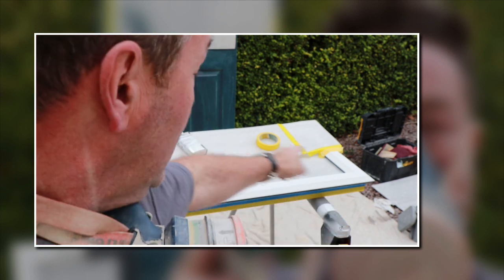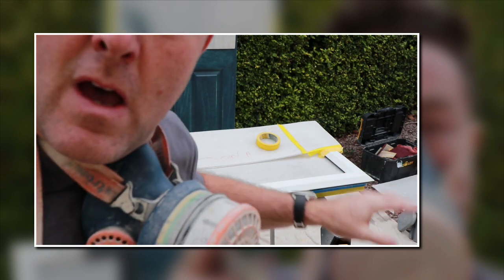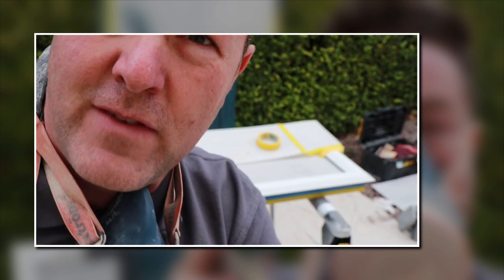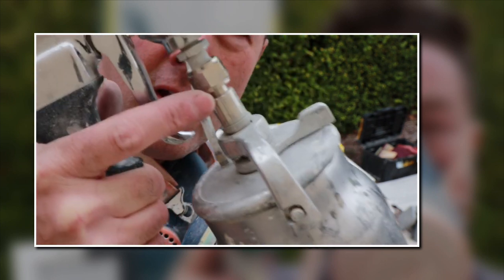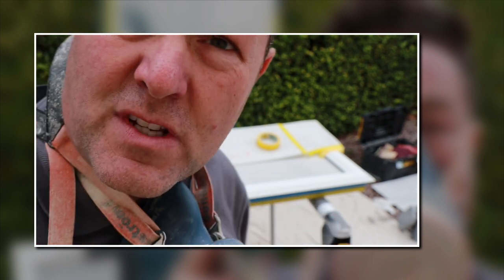I sudsed it all down, dried it off, then went over it with the window prep, which is like the cellulose cleaner. I've got it all taped up. This still takes about 15 to 20 minutes to dry. The weather's a bit overcast but not cold. My plan today is to give you an HVLP opinion spraying this Colourbond Aquatech.